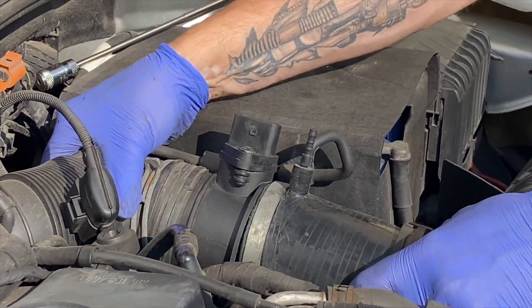It's that simple and absolutely worth doing — just a case of taking it all apart and spraying it through. Normally you'd take the actual mass airflow sensor out, but the tool you need is very specific, so if you're thinking about doing it check eBay or any sort of car servicing site and look for the specific mass airflow tool. It's got a hole, a pin and a multi-spoke — very specific. Make sure you have that tool to take it out; it makes it a lot easier. We didn't have it so we had to spray it through and still get the electrodes, but it's a lot easier and better if you take it out. Thanks for watching and I'll catch you in the next one.